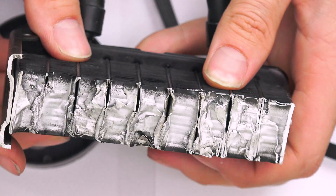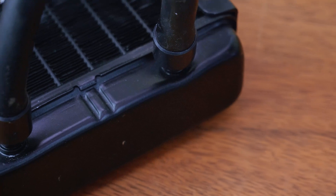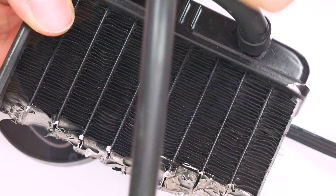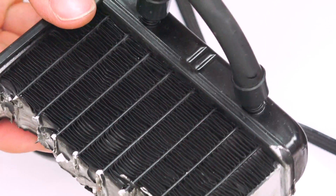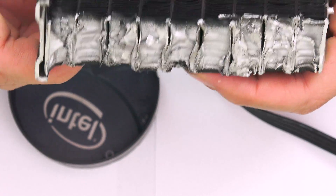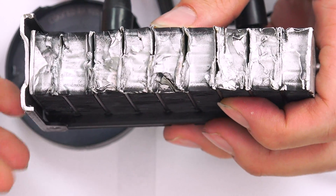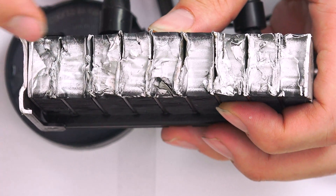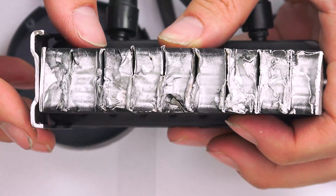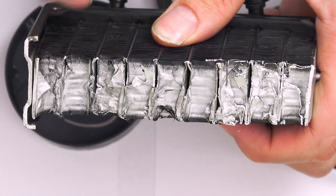Essentially, we'll just start off with the tube. As I did mention, we have this line here for the tank divider — basically from here, one side is hot and one side is cold. So for example, this tube right here would be our hot pipe. The water would come in here and then travel down these one, two, three, four little vertical passageways. If we look inside of them, we can actually see that they are hollow for water to flow through. When I was flushing this thing out so I could bring it upstairs — because this stuff smells really weird — basically when I put the hose onto the ends of these little tubes, one side would spit out four slots of water and the other would do the other four slots as well. So they're a bit messed up and mangled now, but you can kind of get the idea that where these gaps are is where the coolant would actually flow through.